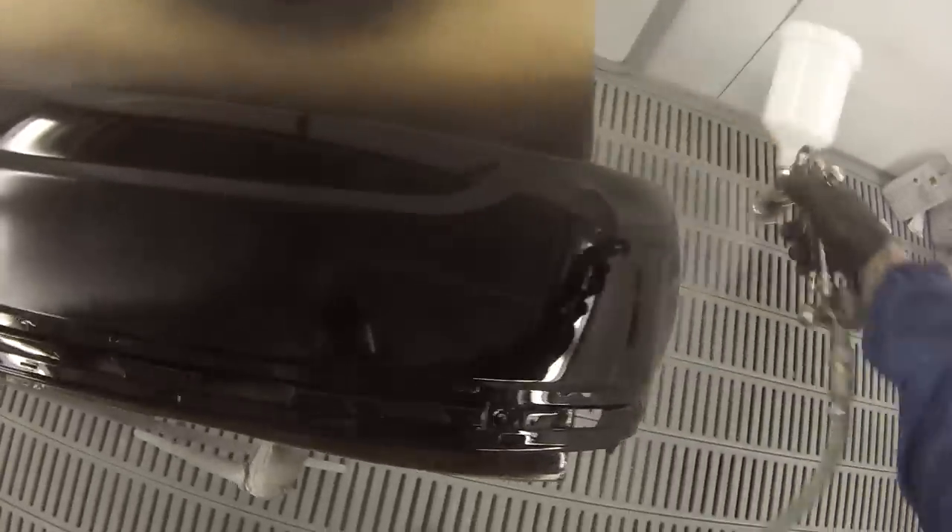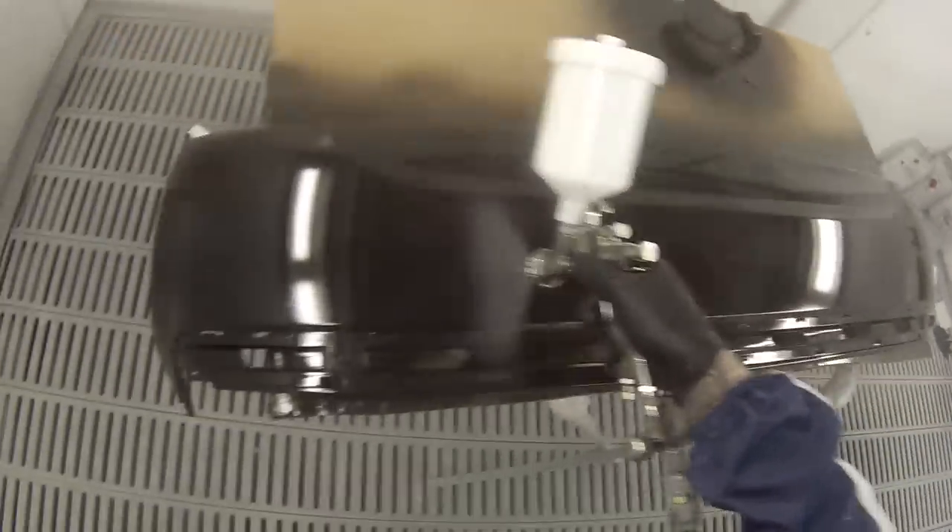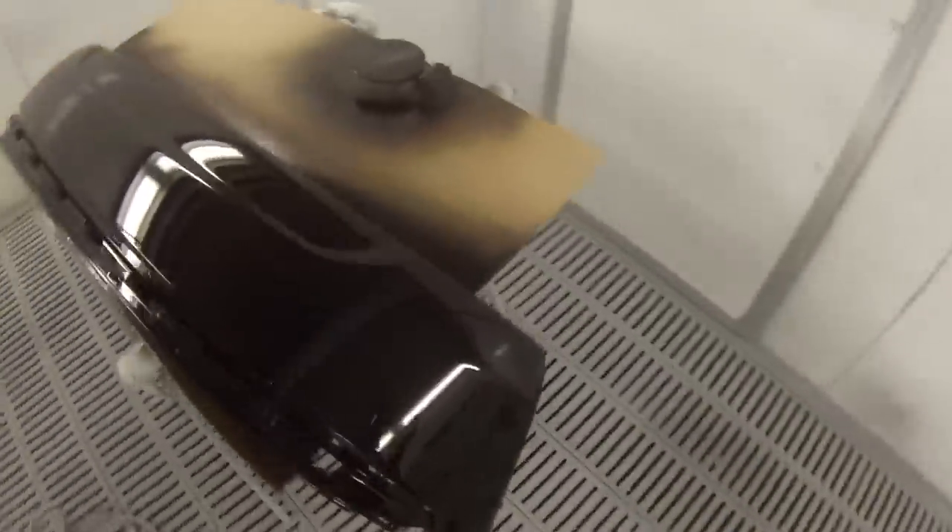To give a quick rehash of the settings on this gun: wind the fan fully out and then come back in two turns. For the fluid, for an average fine orange peel, wind that right in and then two and a half turns out. Pressure is 29 PSI or two bar. As you can see it's about a fist-width away from the panel — it really does have a nice big fan on it. As soon as I grabbed this gun I found it quite easy to use, a lot easier to set up than the Supernova, which does look great and can get great finishes but is harder to set up.